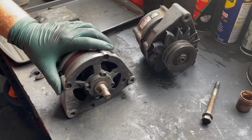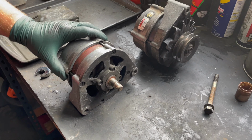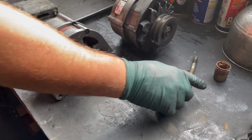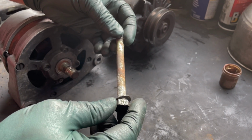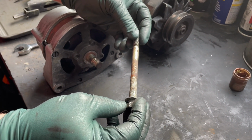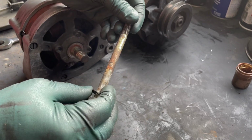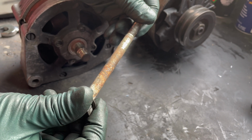And when we pulled it out, right away I said, uh-oh, better get the camera, because there's a couple things we need to show our customers. Number one is this bottom bolt. This is a really clean, rust-free car, but look at the rust that's forming on that bolt. You don't know how many times we've gotten emails over the years where people cannot get this bolt out and you have to destroy the alternator mount.